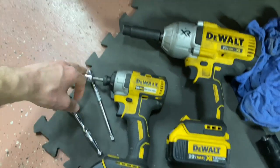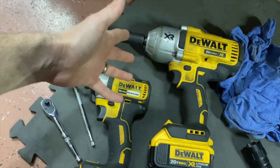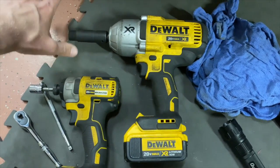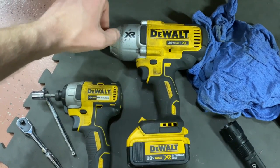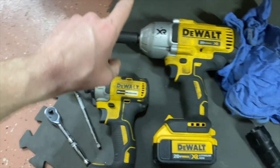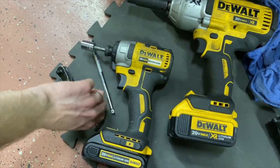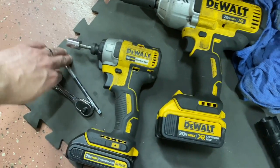Here are some of the simple tools you're going to need to do this job. You're going to need a 13mm socket for the clamps, and there's also a 13mm bolt on one of the brackets that I take off. It makes it just a little bit easier for me, depending on your setup and what mufflers you have stock. I'm using this big impact gun right here because I was ignorant whenever I first put these on, and I gave it all the torque with this, and it did not need that. It was ridiculous. So I'm going to loosen the bolt with this, reapply it with this, because this has plenty of torque to get the job done. You may also need a ratchet depending on your muffler type to get to this bracket if you want to take it off that way, and you may need an extension like this.